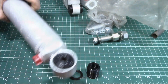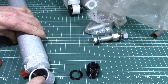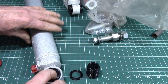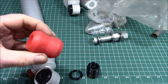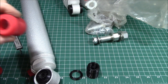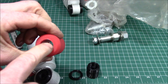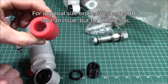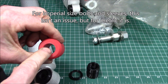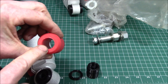On the other end, the Rancho bushing is too wide and it wants a 12 millimeter bolt. Theoretically you could sleeve this bushing, but the problem with all the Rancho bushings is they're all made with imperial dimensions — like three-quarter inch, which converts to 19 millimeters — but that's not a standard metric tubing size.